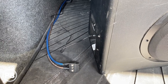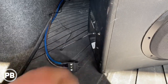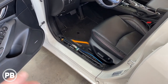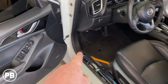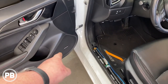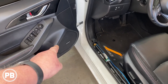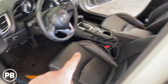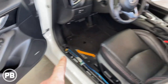We need to start running our bass knob cable, and we need to identify signal to feed our bass amplifier so it knows what to play. In this vehicle there's no dedicated standalone subwoofer as in a lot of Bose systems. What Mazda opted for in this trim level — there's generally a sub in the back deck, but here we just have tweeters. The components up front include a center channel tweeter and a mid-bass in the kick, and that mid-bass is playing the low frequencies — that's the speaker we want to tap into for signal. Because we have Bose, there's a Bose amp underneath the passenger seat where we can snag both sets of signal from one location.